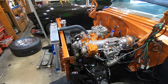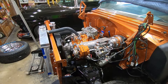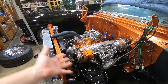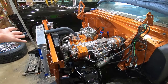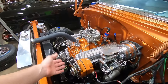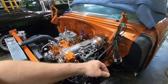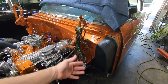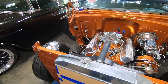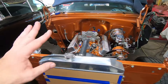The carburetor is on there but not bolted down yet. There's a lot of little finishing stuff to do because some things have changed since we got it running in his shop — some of that work wasn't great and we were trying to use stuff he had laying around. This go-around everything's got to be nice. I've got the alternator adjusted, the belt's tight, the alternator's wired up. All that's left is the headlights, turn signals, horn and stuff — it's going good.